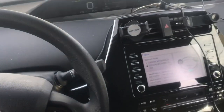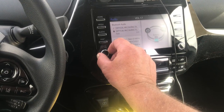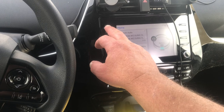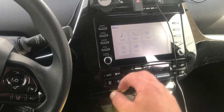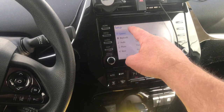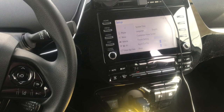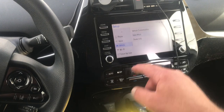We're here at the stereo console, which is how Toyota Prius is generally for the last several years. To undo the auto locking, go to the menu button, then setup. You'll see the list on the left: general, Bluetooth, audio, phone, voice, and then a down arrow. Press the down arrow and go to vehicle, vehicle customization.